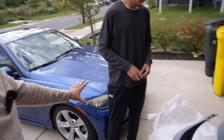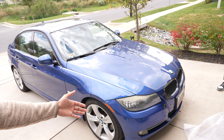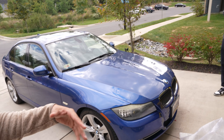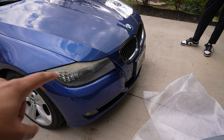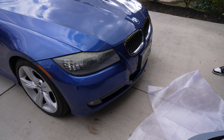It's just a matter of getting this front bumper off - it shouldn't be too difficult. It's pretty much the same on all BMWs: there's a bunch of 10mm or 8mm bolts across the wheel well liner on both sides. From there there's going to be a bunch of clips on the bottom and clips on the top, and this thing should pop off. Luckily there isn't a headlight washer fluid mechanism on this one, which would make it more difficult, so this should be pretty easy to take off.